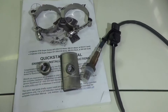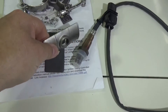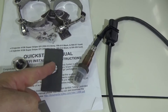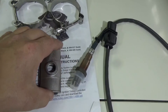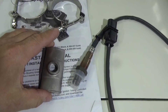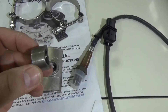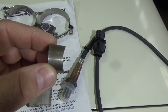When you get your system, there are basically two ways to mount your O2 sensor in your exhaust stream. The first one is the strap-on bung — a piece of metal with threads in it for the O2 sensor. There's a gasket, so you drill a hole for the O2 sensor in your exhaust stream, put your gasket down, put this curved plate on top — shaped like the exhaust pipe — then put two clamps on there, one on either side, clamp it down, and you have a spot for your O2 sensor. Or you can use this kind: a bung that is welded on to the exhaust pipe. It's got an angle on it and it's round so it fits nice and tight against the pipe so you can weld it. This is what we're going to weld on.